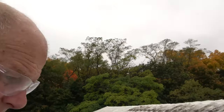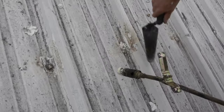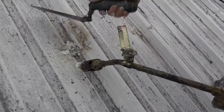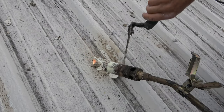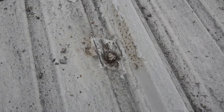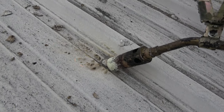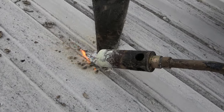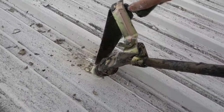To fix the problem, you have to clean every fastener, tighten it up, and coat it with a sealer. First thing we do is remove the silicone and caulking around the fasteners — we use a torch to soften it up. If we don't know which fastener is rusted, you heat it up with the torch, then take a towel and pull it out. Make sure you get it all out.